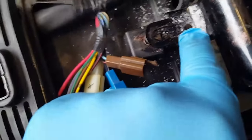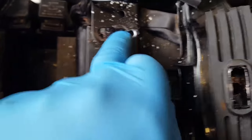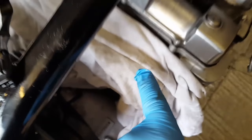Right, I've drilled them out to 6.5mm, and now I'm going to probably get my Dremel and try and make that into a slot. I should have used my big mains powered drill, but I got through with the battery one. I've got a rag over the inlet. I should actually put that over the carbs as well.